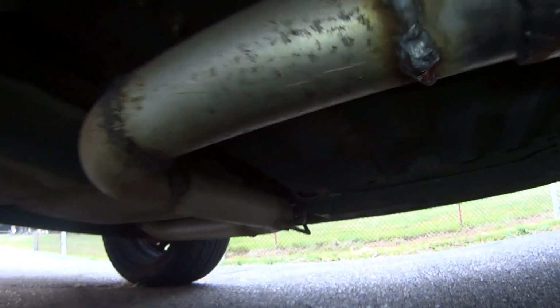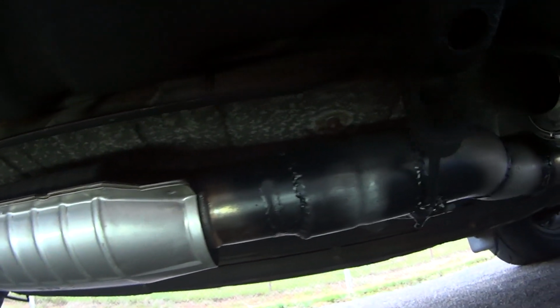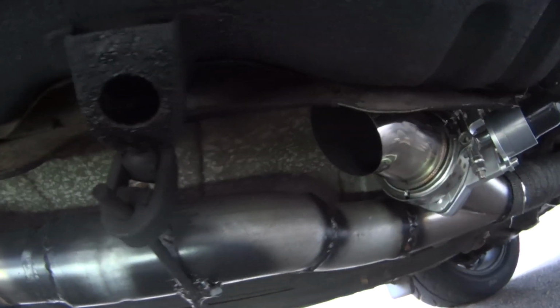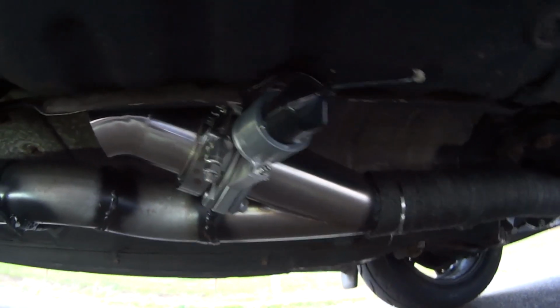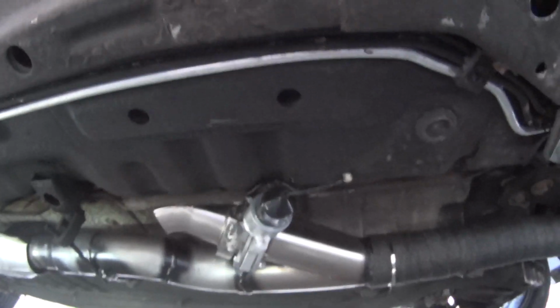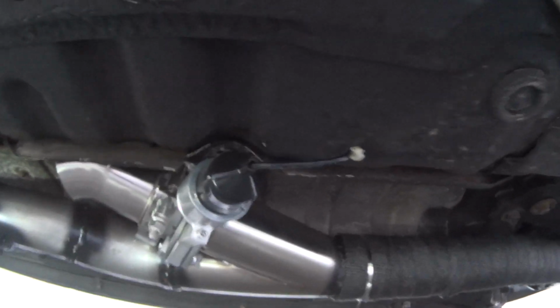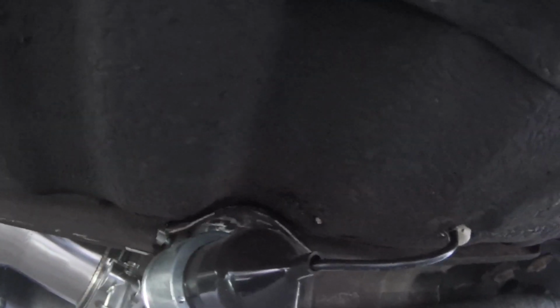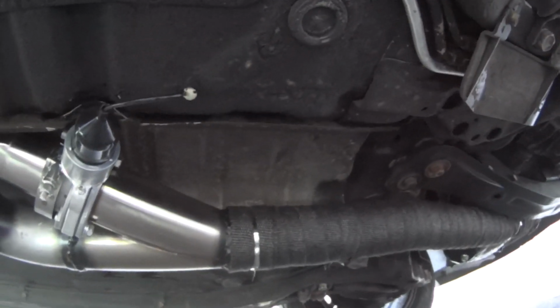There's a 1/2 inch of clearance everywhere. I've been driving around with it on bumpy potholed city streets, and there's not one rattle or ding anywhere in it. We clearanced the floor pan slightly on the passenger side to make more room for the servo motor. We could have maybe got it by without doing that, but it let us clock it up tighter to the body, making it more invisible if we did, so of course we did it. The pipe shortening up front on the bend section moved all this over, just enough to one side to make room for the cutout to fit as if it were made for it after the clearancing was done.